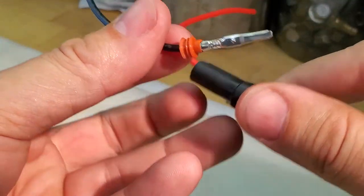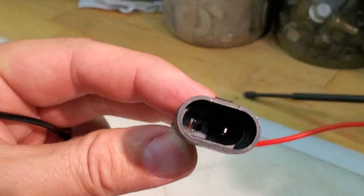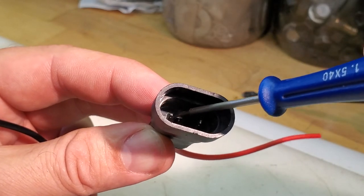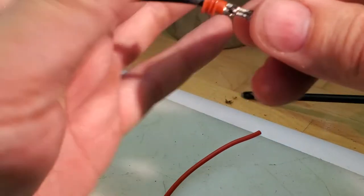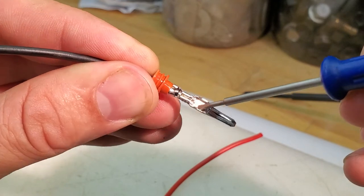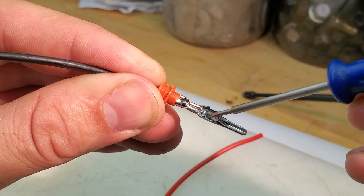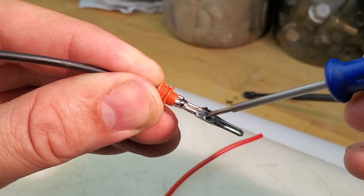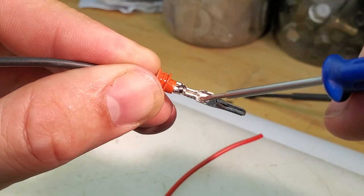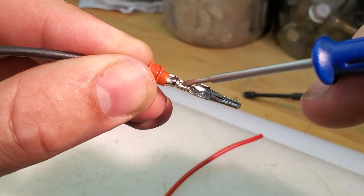The better the connector, the more difficult that is to do. But essentially there's a plastic connector — you'll be able to see it — that goes in and catches on this recess in the pin. Sometimes these pins don't work correctly if there's too much wire exposed here, as it takes up the void in the recess so the plastic clip won't work. So if you're having problems with these not staying in, check to make sure there's not an excess of wire. If there is, simply cut it off — it's not needed because it's already crimped. Cut it off and you're good to go.